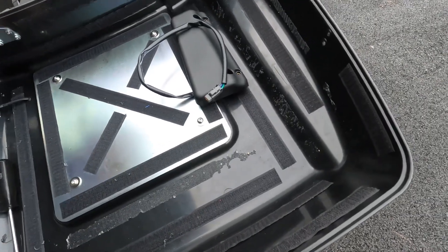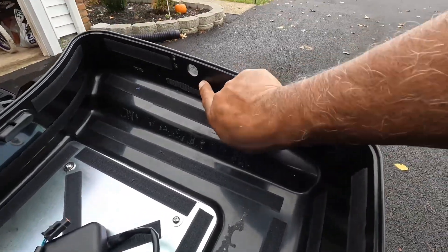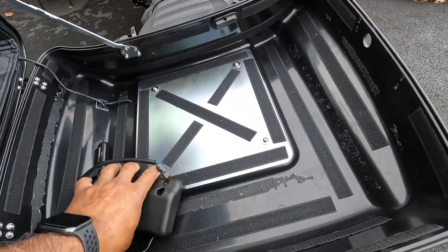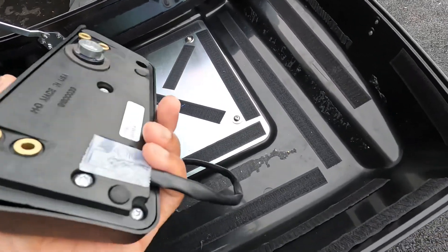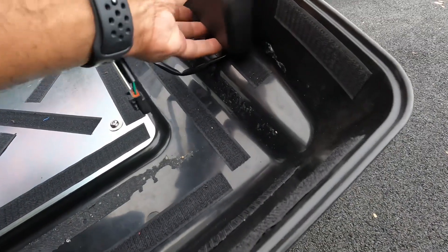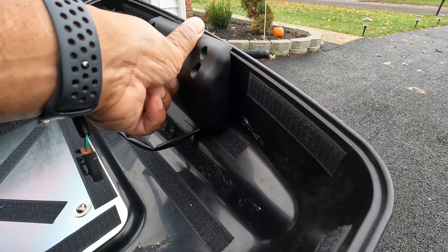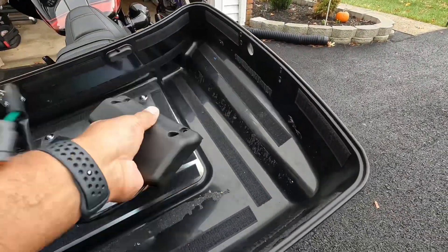Here's my issue now — this is the actuator, and I already drilled my hole for the lock to come through on the other side. But the issue I'm having is that originally these actuators come on king tour packs. This is a chopped tour pack, so when I line it up — hopefully the camera picks it up — the bottom of this actuator is too long because of the chopped tour pack size. So I'm gonna have to do some plastic surgery.